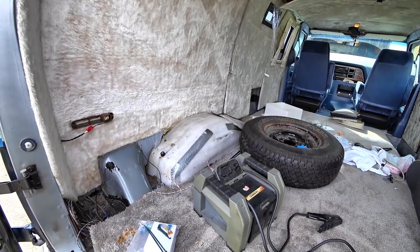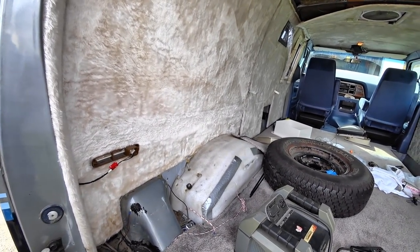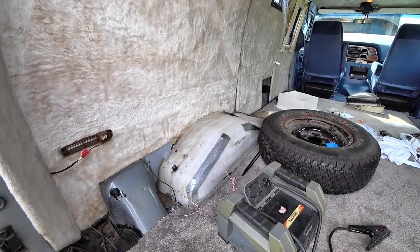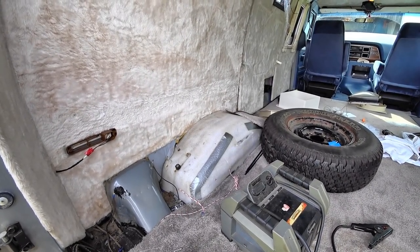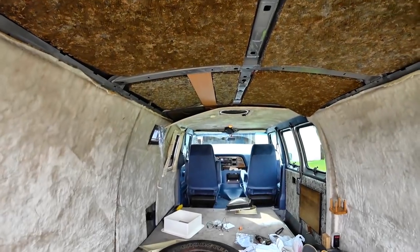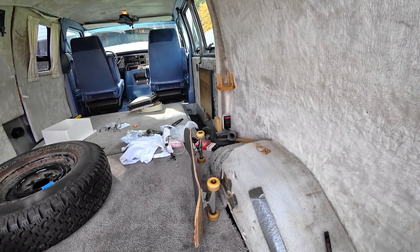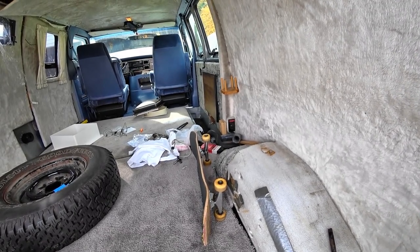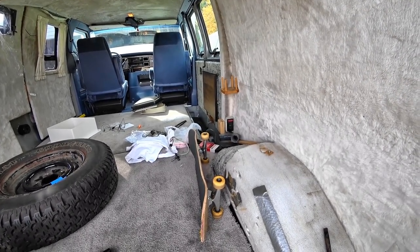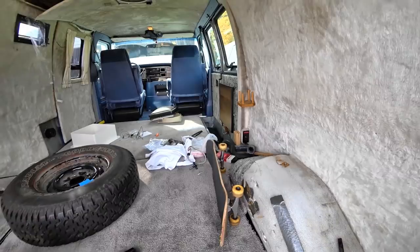8 gauge at the length of this van should be able to run his refrigerator, which says it's about 5 amps operating — I think it's probably closer to 5, maybe 5 and a half amps. You need an 8 gauge for this length to be able to power that, and everything else should be okay as far as what it can power. I don't know about that 12 volt setup there — I don't know if there was an inverter that is now gone. We'll go through this wiring and see what we can find.